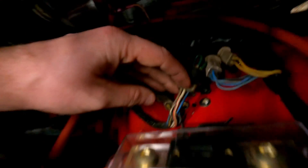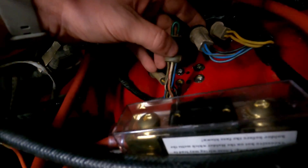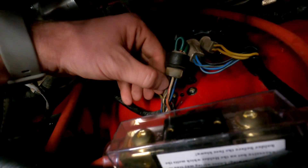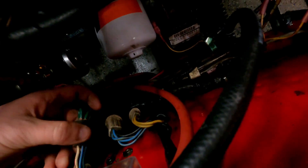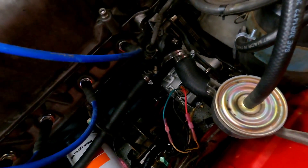We jump power — you can see here the white and red wire, which pretty much universally around the car means constant power all the time. You can see that's going and just jumping to this yellow wire, which is the same sense wire or at least in the same circuit. The other one you're going from a blue to a white and black wire. I'm not sure exactly what that does — I'll probably take a look at the diagram to confirm.